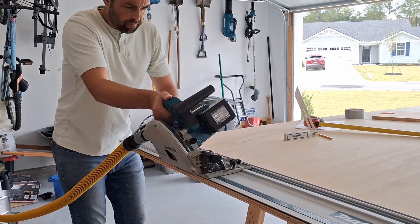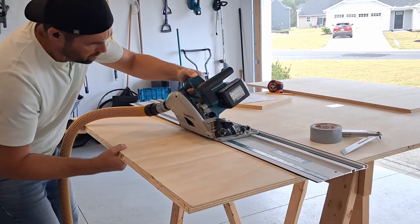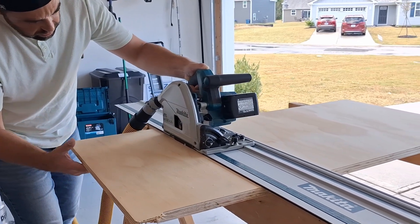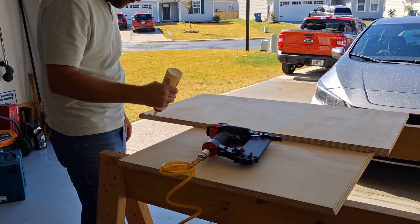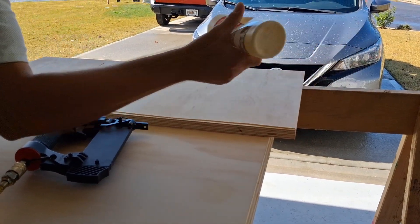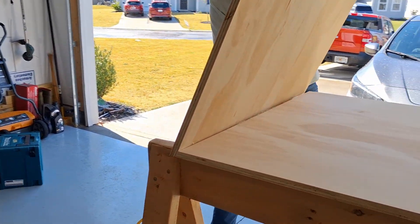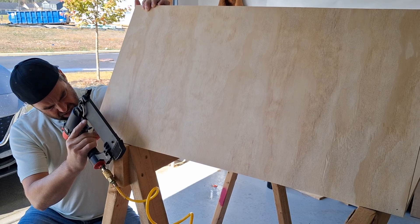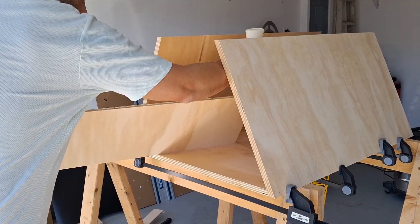This isn't a build channel, but I want to quickly share how we built this enclosure, because it's going into a hatchback and there are some difficulties — it's a challenging build. I figured it's important when evaluating a driver to understand the context. I started by building about a 125-liter sealed box out of plywood. For the purposes of this video it's sealed, but it's going to be ported eventually. At this point it's not even braced.